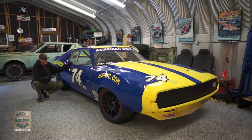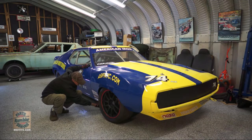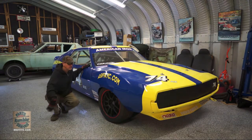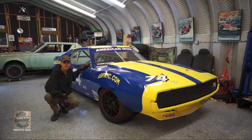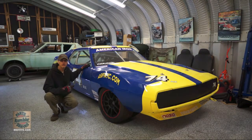Phase one of going low is complete. I got the IFS cage swapped out, put in shorter nine-inch springs in the front, installed two-inch drop spindles, and lowered the coilovers as far as they'd go. I was able to get down to six inches in the front at the rocker panel, but at that height the car wasn't drivable - the wheel couldn't be turned, the fender lip was interfering, and the exhaust was barely three-quarters of an inch off the ground. In the rear, fully lowered, I could only get to seven-and-three-quarter inches.